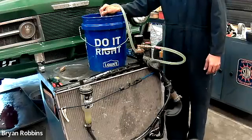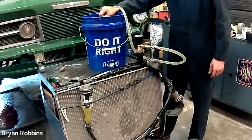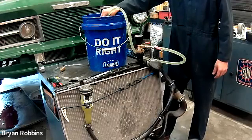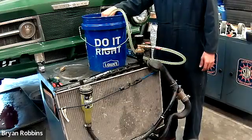We managed to do a full coolant drain and refill — and there it goes, the coolant is filling up from the bottom of the bottle. Now we have a system we can start, run, and we're not going to have a blown cylinder head because of an air pocket stuck somewhere behind the thermostat.